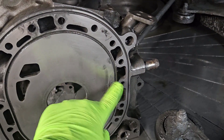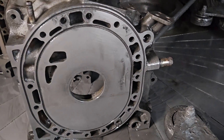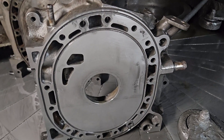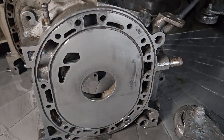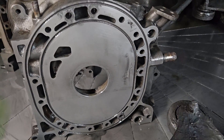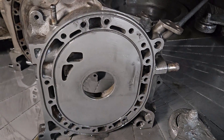That water seal was never going to go that far. Lapped flat, still within specs, this housing can easily achieve 80 to 150,000 miles — even with this lapping. Obviously more horsepower and more performance wears things faster, but if this was an OEM car, this would be back to OEM spec for all intents and purposes once we finish up a little more work.